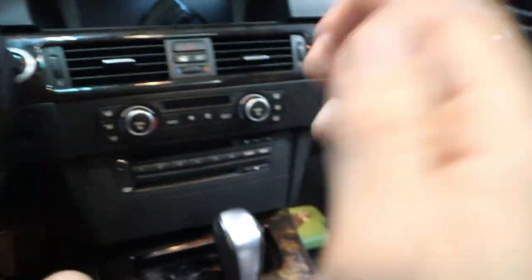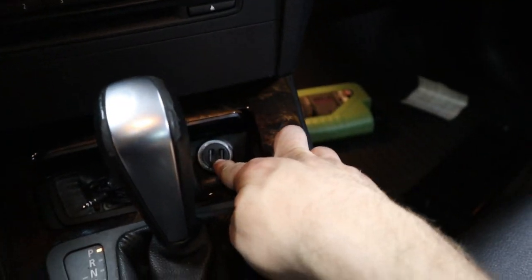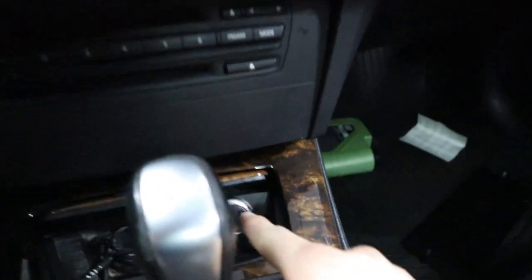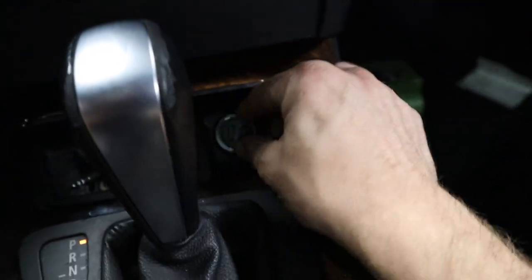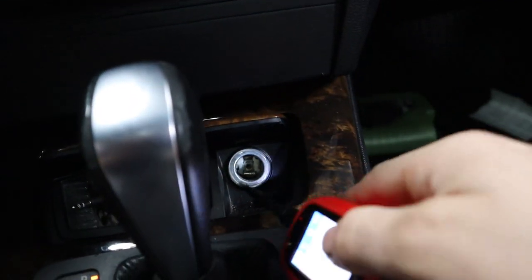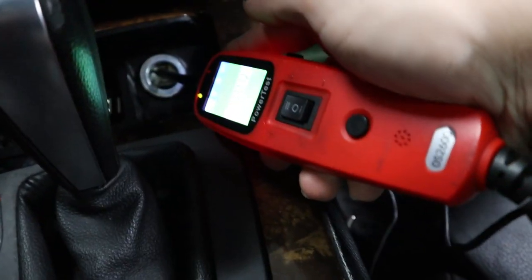The problem inside my BMW is that the USB charger does not work. We'll go ahead and turn the car on, and when the car is at key-on position this thing should get power, but you can see my USB charger does not light up — there is an LED in there. Now if I wanted to be sure it wasn't just the charger malfunctioning, I could go ahead and check the socket.